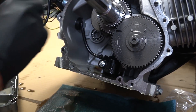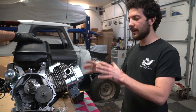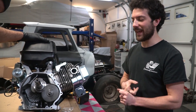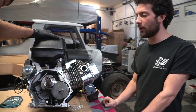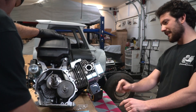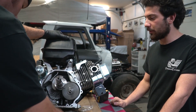We're also going to get rid of the low oil cutoff. Be sure that when you're ordering performance parts, you match whatever kit you get with your engine. We have the Hemi version of the Stage 2 kit — part number 60349 — and this is a Hemi head engine. This Hemi version has six bolts, whereas the non-Hemi version has just one bolt in the center of the valve cover.